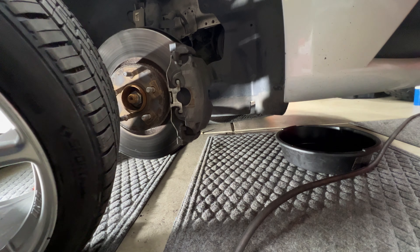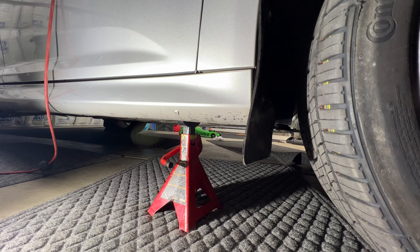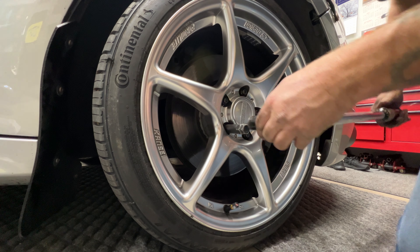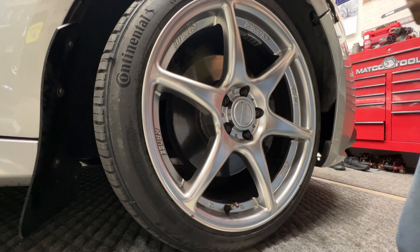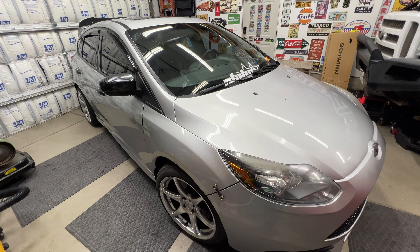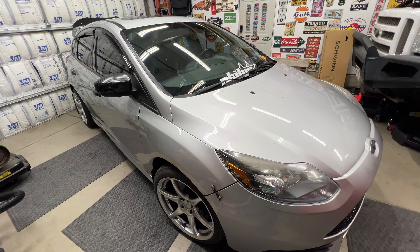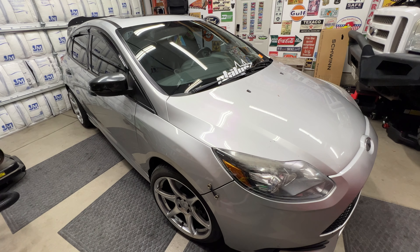Now that the lock nut is in place, go ahead and throw your wheel and tire back on. Jack it up, lower it, grab your torque wrench and torque your lug nuts to 100 foot pounds. That's all there is to it - this was a 2013 Ford Focus ST, went ahead and replaced the inner and outer tie rods, pretty simple job to do on these cars. I'll take this in the morning to get an alignment done. I did do a separate video on replacing the lower ball joints, so if you're interested in that check that video out. Hopefully this video helps you out - if it does, why don't you subscribe to my channel, check out my other videos, and I'll see you in the next one. Thanks for watching.